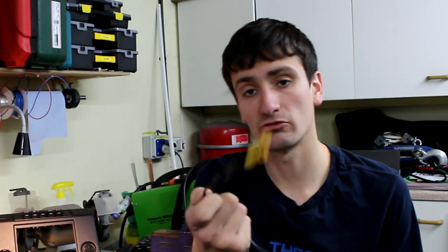Another key thing that's evolved throughout my wiring experience is the way I protect cables. All too often I see installs with what I call bare cabling — running over sharp corners, through holes that aren't grommeted, rubbing against other cables, or right near sources of heat like your exhaust or engine. That is where a lot of wiring failures come from — that and undersizing wires, which I'm not going to get into here. If you want to know the basics of cable sizing and 12 volt wiring, tell me in the comments and I'll do a video on it.